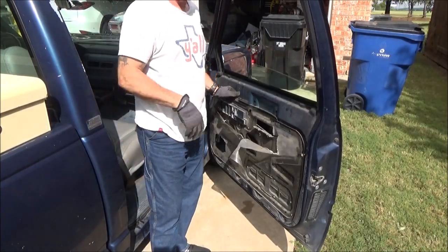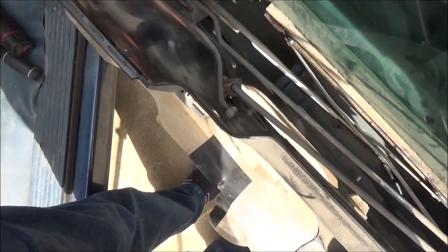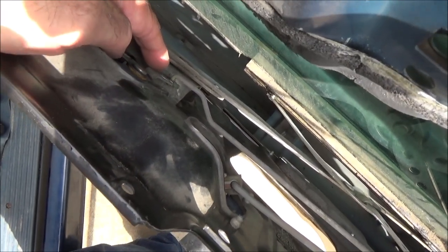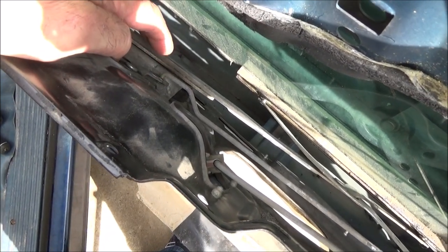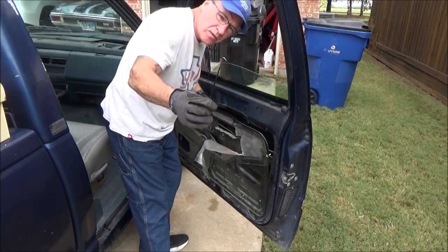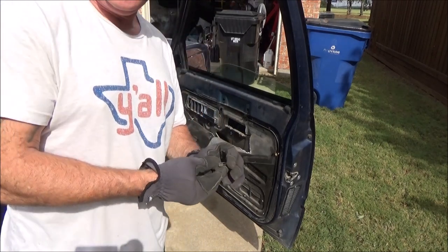I'll give you enough room to get to the stupid clips. That's one right there — that's for the handle, and that's for the door lock. It's hard to see in here, but there's a little tiny latch that you've got to pop out and then push the clip down. You want to try and save these because these are hard to find. Use this little guy right here — it gets under the latch.